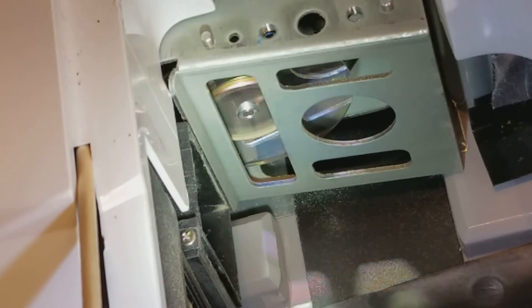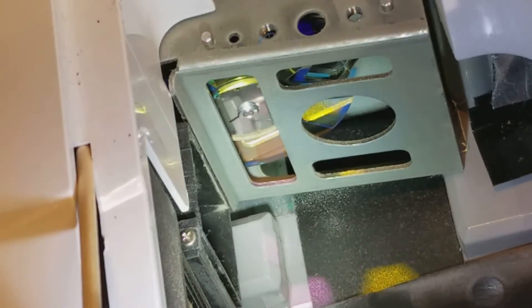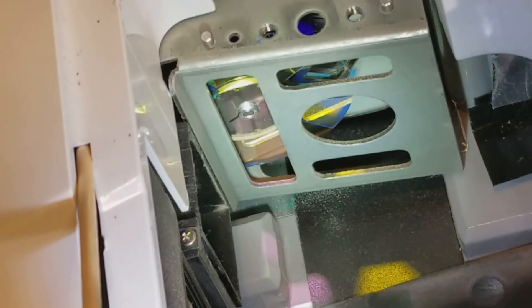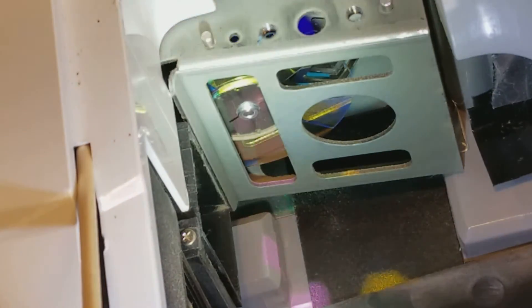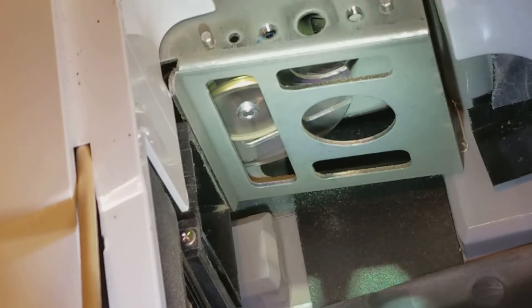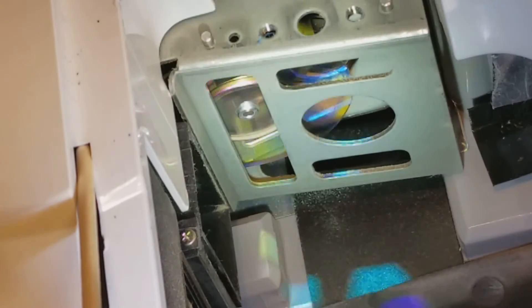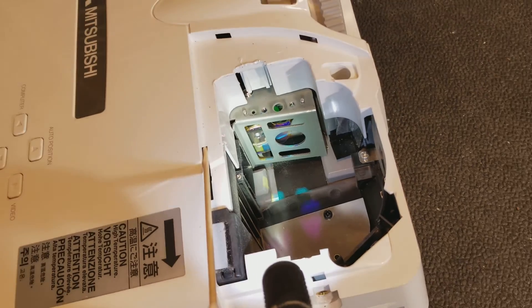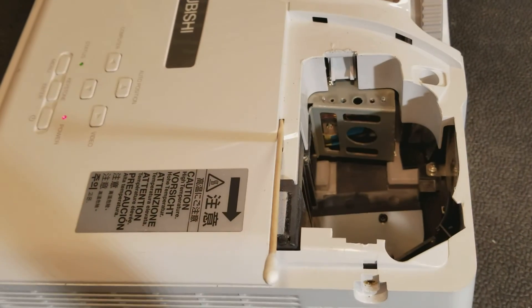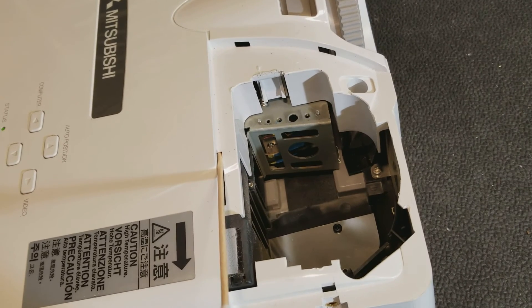This is the second attempt. If the lamp were hot and had turned off, this gives the lamp time to cool down so that it can be reignited — these are arc lamps, not filament lamps, so they do run differently. This last startup should be the last one before it goes into lamp error. If this were a real troubleshooting session, we would know at this point that the color wheel is good because we don't hear it making any funny noises or see it moving erratically. We would move to check other things like the lamp, the ballast, that sort of thing. And now it's giving us the flashing power light, telling us that the lamp didn't light. So that confirms that the color wheel is functional, and that shows you how to make sure your color wheel is running.